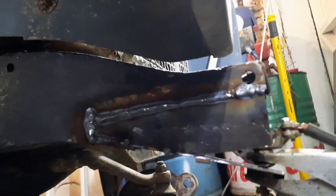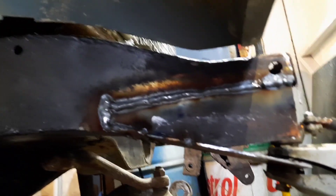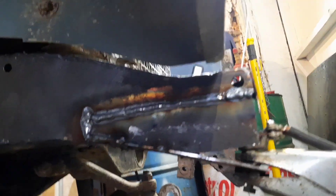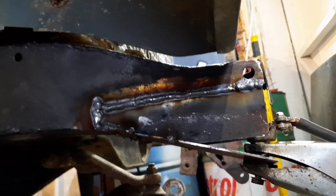I've just started welding the bottom section of chassis in — I've cut a piece out and slowly but surely I've tacked it and seam welded it across the back end. I'll keep seam welding it a little bit and then try the spring hanger in just to make sure it fits.